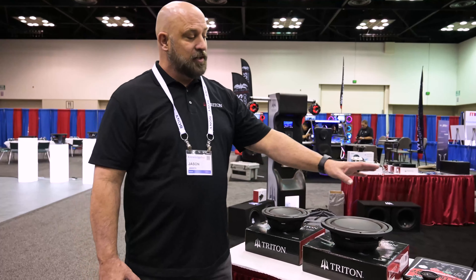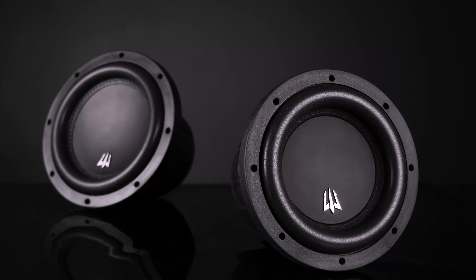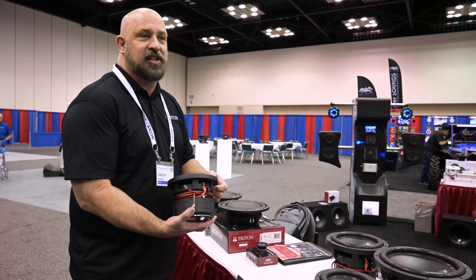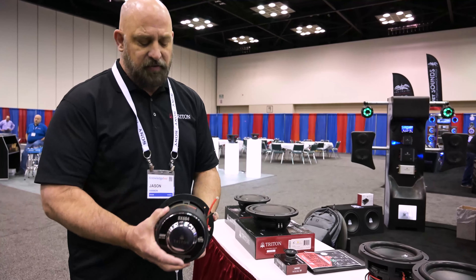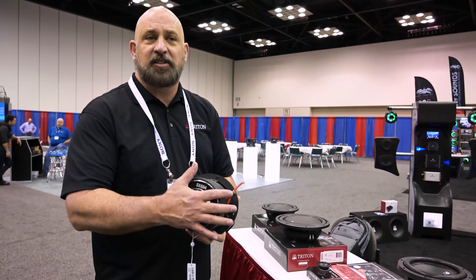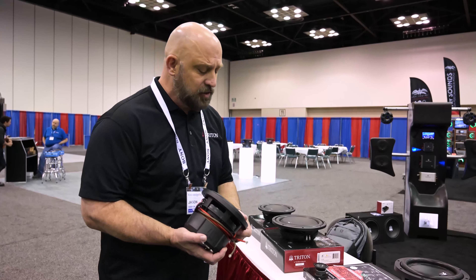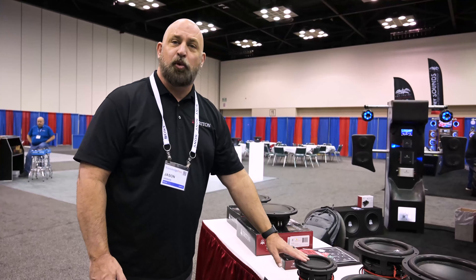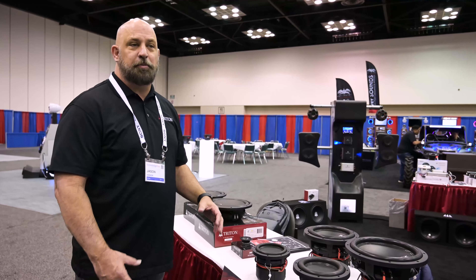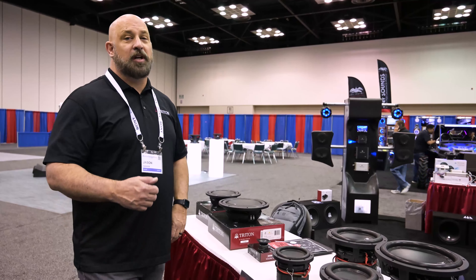If you want to step up from the STs, you go to the SX series — our big bad boy series. Available in 6.5-inch, 8-inch, 10-inch, and 12-inch, all dual 4 ohm or dual 2 ohm, with OFC cable pre-terminated. These things are monsters — double stacked magnets. Even the 6.5-inch is a 300-watt RMS. It has a sealed backplate so you can mount it right up against the back of the box for easy, shallow location. These are a super sound quality woofer — not a one-note wonder. The 6.5-inch fits in a 0.3 cubic foot sealed enclosure, the 8-inch in a 0.5, and the 10s and 12s are under a cube. Really allows you to put these in any application with great power handling and amazing sound quality.